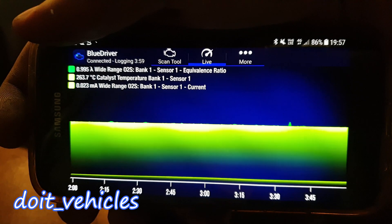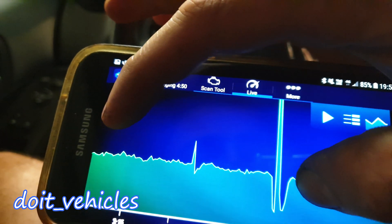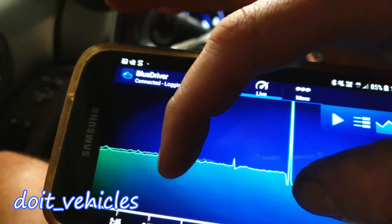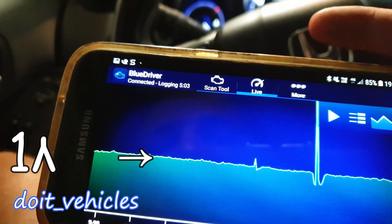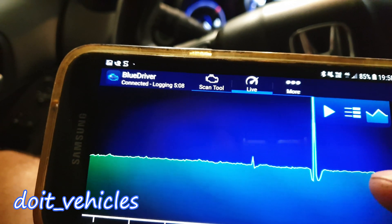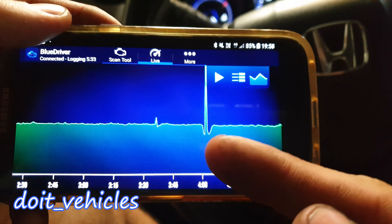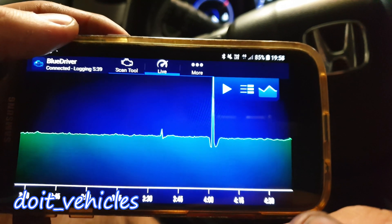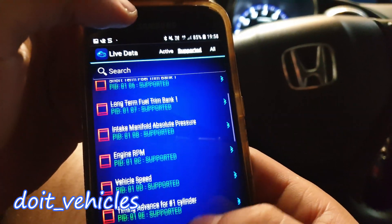When I press on the accelerator pedal, the sensor reads rich. Here you can see when I press on the accelerator pedal, the sensor reads rich, and then a big lean condition, then rich again, and then it stabilizes back to 1. This is the response you want to see on most of these air-fuel ratio sensors. You press on the acceleration pedal, you see this graph behave this way, and this is 100% confirmation that the air-to-fuel ratio sensor works fine — you don't need to do further tests.